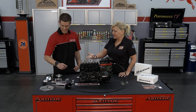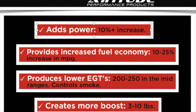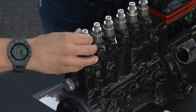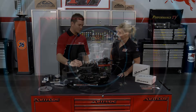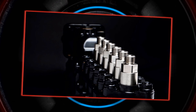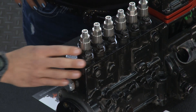The bolt-in freeze plugs are for the rear of the block — you don't have to remove the transmission. Really clean, dresses up the engine, and reliability is the main thing. With the adjuster, we're talking about more power, more boost, less smoke, increasing your fuel mileage, extending the pump life, and so much more. We've also got the billet delivery valve holders with a .093 bore hole — it flows more fuel, helps with fuel economy, less stress on the pump, less restrictive. They're awesome. And cheap horsepower — easy too. It's a 19-millimeter wrench, you can just take them on and off easy. The stock spline style requires a specialty tool. Simplicity — dress up the pump and cheap horsepower.